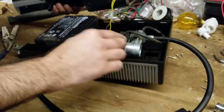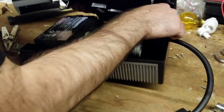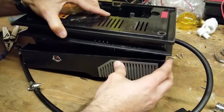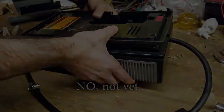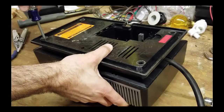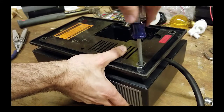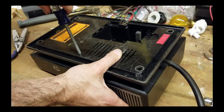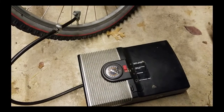Just making sure all the shock absorption stuff is in place and the wires are not in the way. Like my vacuum cleaner servicing video, these are metal screws going into plastic bosses — nice and easy. I usually let my finger start slipping on the screwdriver as a feel indicator for when it's tight enough. Alright, we're hooked up to the bike tire — let's try it out.